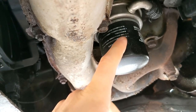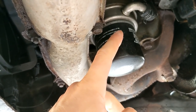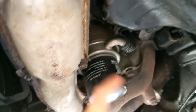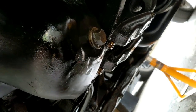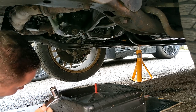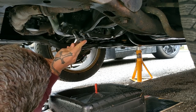Oil filters are notoriously difficult. I don't have an oil filter wrench, but if it's difficult I do have a Phillips head and a hammer - that's another way you can get these things off. Basically we're going to position an oil drain basin underneath, pop the plug out, and go from there. For this you need a 17mm socket and it should be quite easy to be honest.